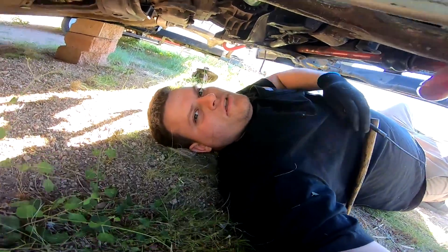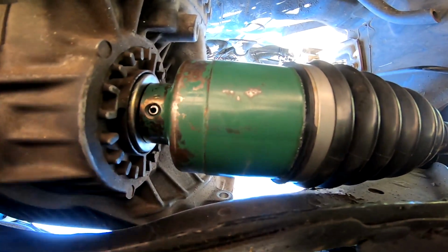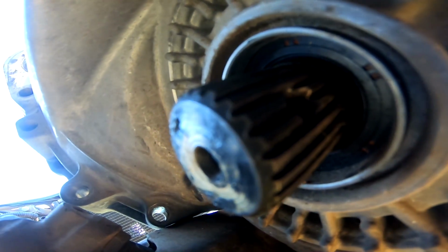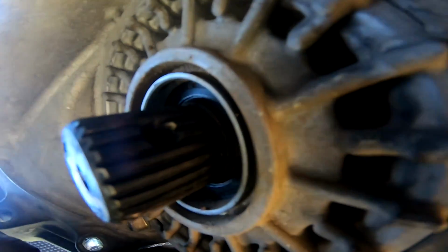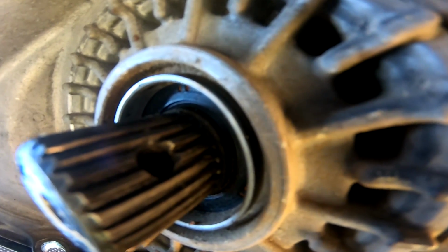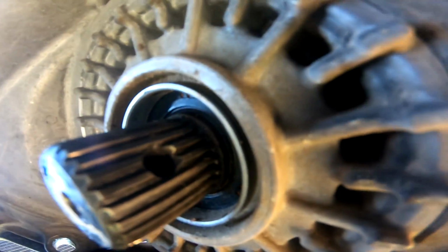The cool thing that I found is that the beveled surface right here, and then the circular surface on the other side is not beveled, actually matches the transmission. So you can see, this dog is gonna come maul me, but there's a beveled inner right here, and the outer on this side is not beveled, so you can actually match it to the axle. So there's no tooth going through on the backside, so you don't have to worry about hitting it the wrong way. I think there's still a direction, but it's easier to match up the axle, and that's all that matters.